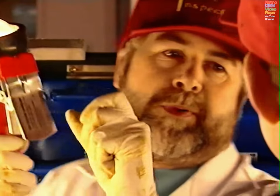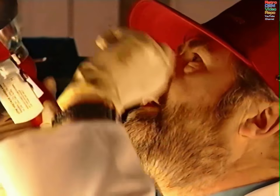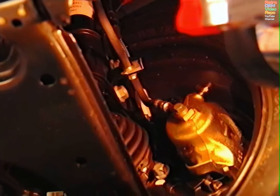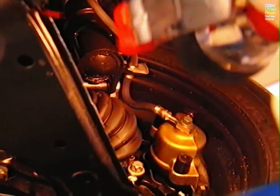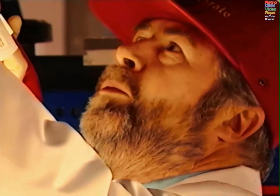And now we've gone full circuit. Has that completed the checks on the service brake? It's completed the checks with them under pressure. We've still got pressure on it, because we're now going to check the brake hoses in particular with it on the turn plates. Normally this would be incorporated with a steering check — we're just going to concentrate on the brake hoses, and it's a lock-to-lock check. Full left-hand lock please, Paul. And now we're checking that the hoses aren't stretched, kinked or twisted. Full right-hand lock please. Now we're checking that there's no fouling, no kinking, no twisting. Straighten up now, Paul please. We would repeat all those processes on the lock-to-lock on the offside wheel as well. Okay Paul, switch the engine off please.